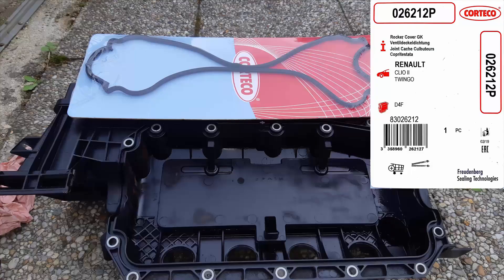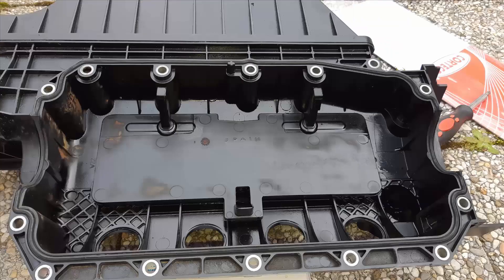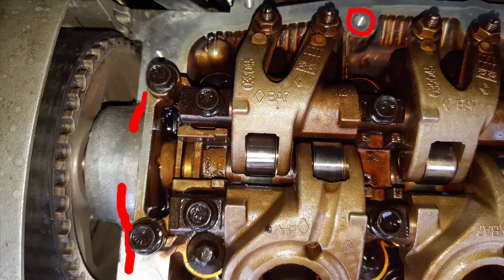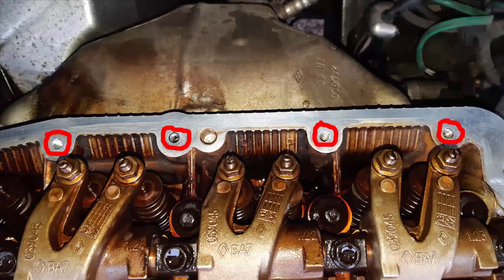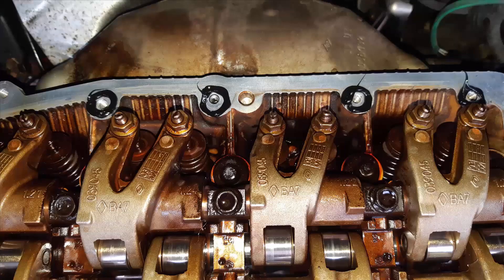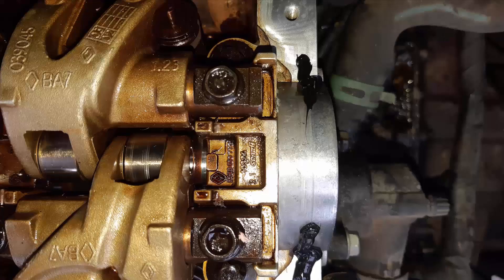Here is the wavy seal — the seal of the valve cover. Be sure to place it correctly and seat it correctly in its recess. Now in red we have the places where we need to put the sealant. Let's have a close look at the timing belt side, the exhaust manifold side, and the gearbox side. Here in black is the real sealant applied at the timing belt side, exhaust manifold, and gearbox side.